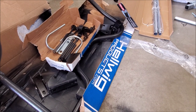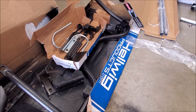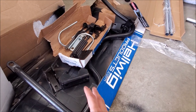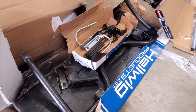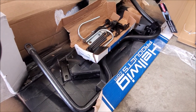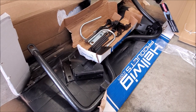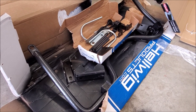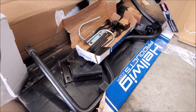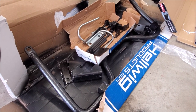To help deal with all that extra weight and extra height, we're going to go with a sway bar. We have all those other devices, and having a dedicated device like this to help control the axle and control the truck is going to be a huge advantage when driving down the highway. This is a Hellwig Bigwig, and we chose this one because it's the biggest one available for the truck. Because we have this payload on the truck all the time, you might as well outfit it with the proper parts.